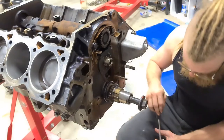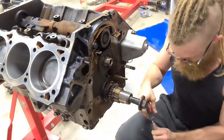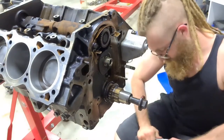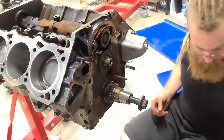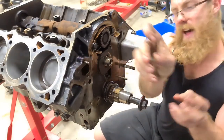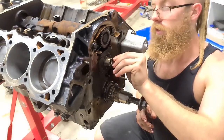If like me you had to replace your cam because the old one was damaged, you may have to grab your little keyway out of your old cam. These you can buy new from most parts stores anyway — it's like a little half moon key. There's a little notch on the camshaft itself which in this case is on the side.